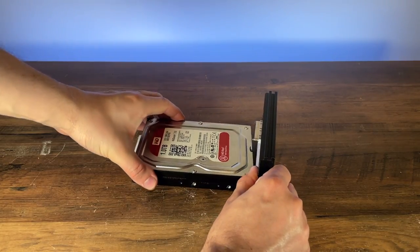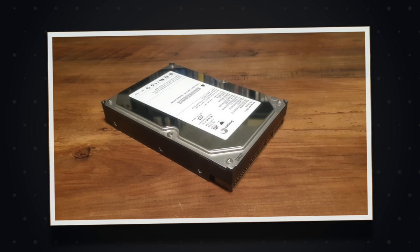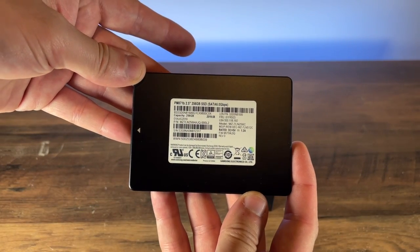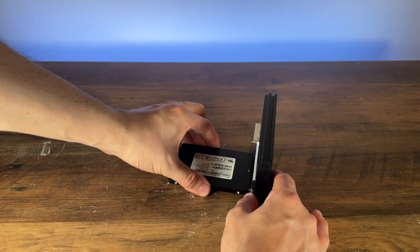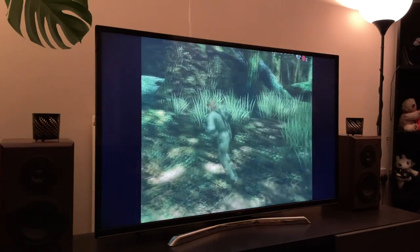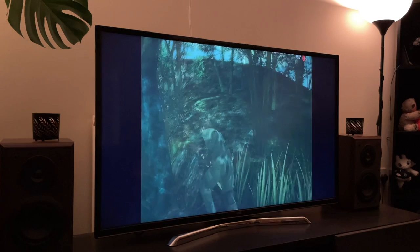The first thing to do is remove the old HDD. Now previously I had stated that in this case it doesn't matter whether you get a SATA 3 HDD or an SSD — it's still going to be limited to ATA 66 speeds. So why am I adding an SSD? Well, you won't get any faster speeds, but after reading through a lot of other users' posts and their opinions on the matter, I'd completely forgotten that seek times would still be less and of course SSDs are silent. And that brings me to the other thing that's bothered me — that fan is just so noisy, and it's got to change. So I will be fitting a silent fan in its stead.